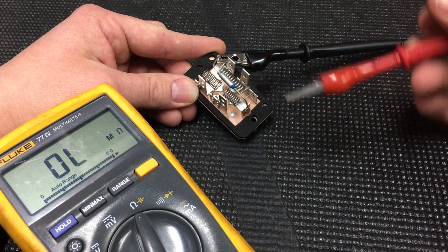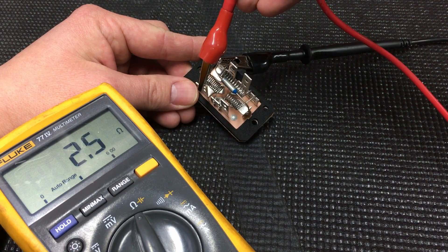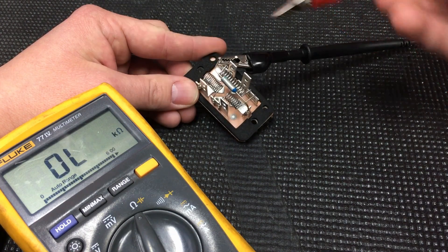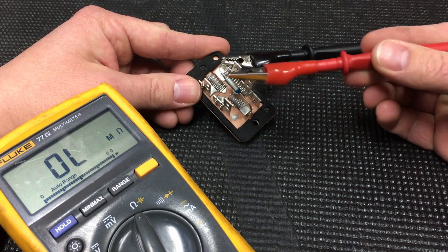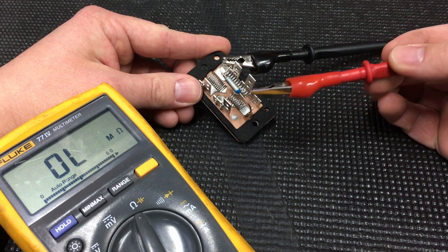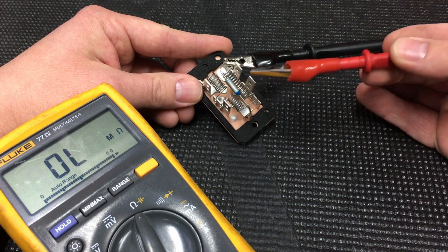Going through another resistor: 1.0 — so that's two resistors equaling 1.0 ohm, because resistors in series add up their values. Now going through a third resistor, you can see it right here — this is our low output: 2.4, 2.5. You can see how it works by going through all these different resistors, and the idea is to make sure everything has continuity through here — if so, the blower speeds should work.